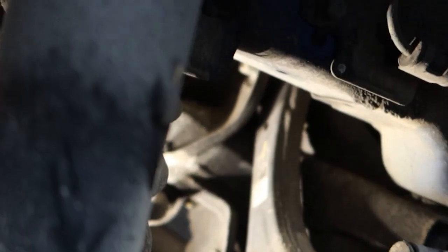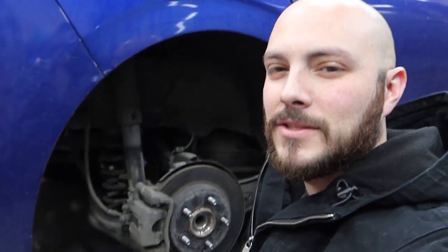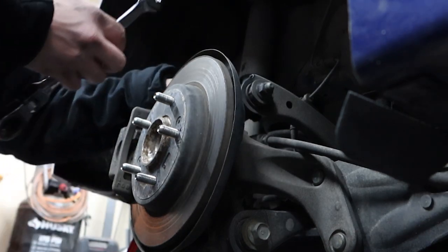You can see there is the bolt and the nut is back here. The nut is way up there — I can feel it with my hand but I can't see it. So unfortunately this could turn out to be a pretty difficult job. We're going to go ahead and remove the front bolt first, then try and get on the rear. It's going to be a 19mm wrench and a 19mm socket — both sides are 19, which is nice.